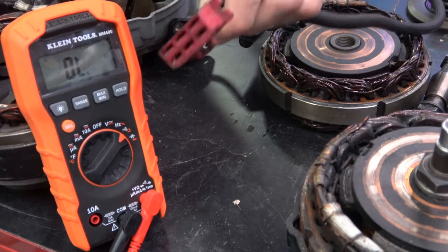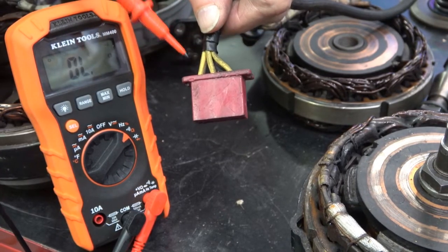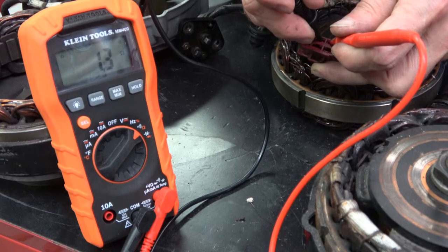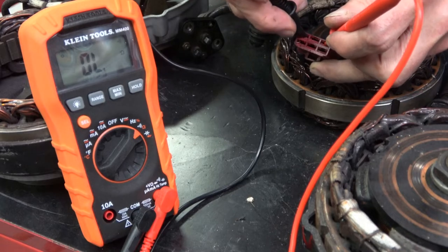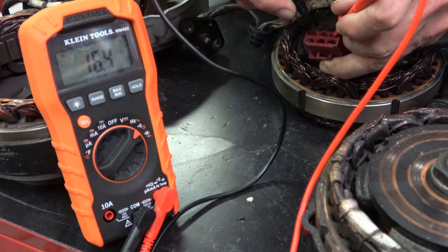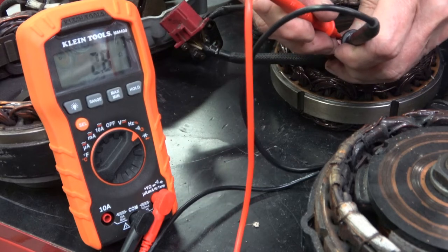The other thing you want to check is the stator itself. You have a wire harness with three yellow wires right there in a row. You set the multimeter on the ohm setting and check continuity between those three wires — you're looking for a reading somewhere between 0.5 and one ohm. As long as you get a reading like that, you have continuity between the three and you're good to go, confirming the stator windings are all connected with no breaks.